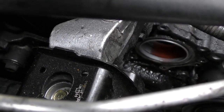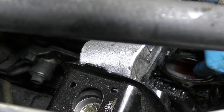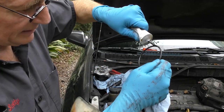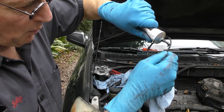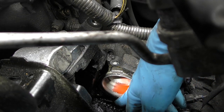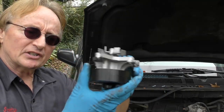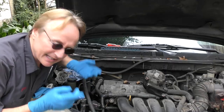Now the trick here is the rubber gasket goes into the hole, but it'll keep falling out, so you need a little glue. I like this 3M black — you get a little bit of it and put it on the inside of the ring in certain spots so it'll stay in place. Push it in the hole with the glue facing in. Now comes the hard part: patience. You want to wait half an hour for the glue to dry, because the last thing you want is when you slide this in is to have the gasket go sideways — then it's going to leak. Wait about half an hour so the rubber seal stays in place. Now the glue is dried.